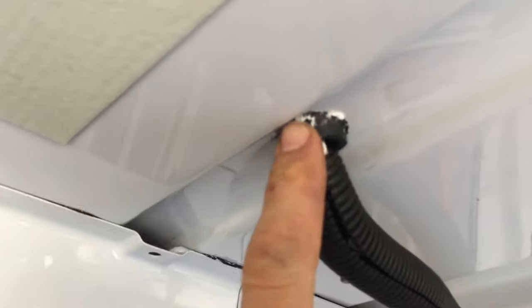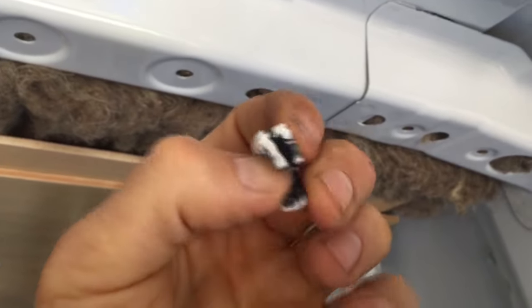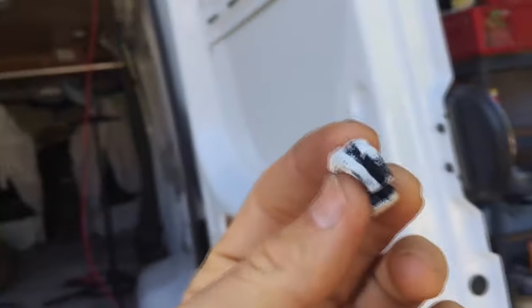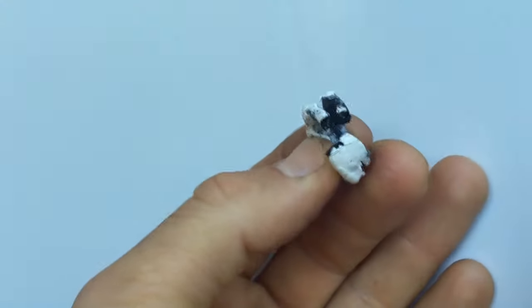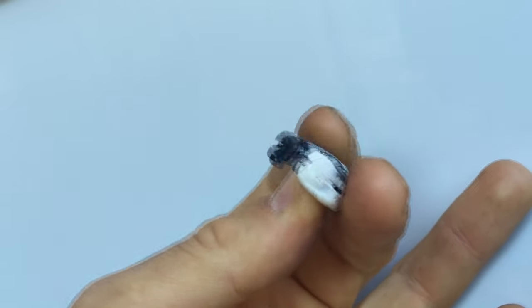Now what happened was when we drilled this out, we put one of these little grommets in. Now it's covered with the Dicor lap sealant. Let's go outside and look at what happened here. And the steel shards, well, anyway, if we can catch that. The steel edge cut through this thing. This is a GB grommet. Wasn't nearly enough for what I had.